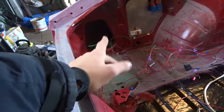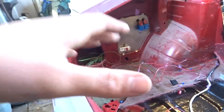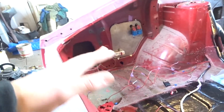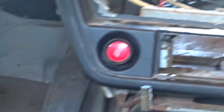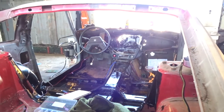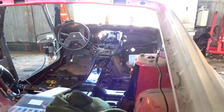There's still some wiring left there — it's because of these two relays. These were my fuel and main relay. I'm just going to keep them there for now just to make sure that it works. When everything works, I'm probably going to get them away from there. This is the power wire for my starter. It works because of that little button right there — it only works when my contact is on start. For some reason the ignition key lock thing is broken, so the last part doesn't work properly. It's just like this — it works fine and I like the button.